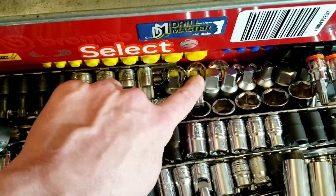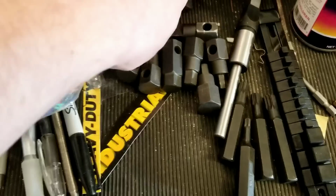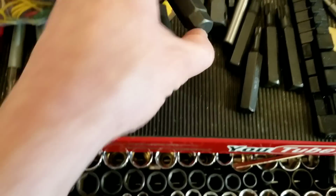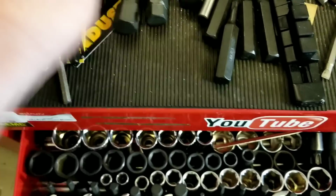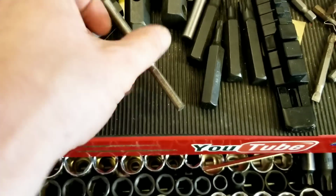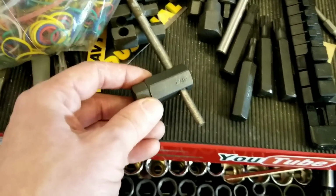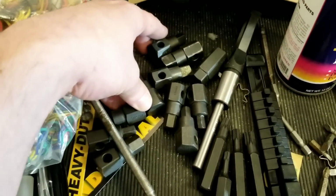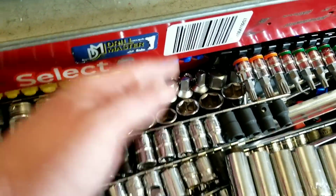So down here I did a review of this oil plug socket set. That was like the 2nd generation Harbor Freight. There's actually a 1st generation of these things. This is the 1st generation oil plug socket set. So oil plug sockets are various square sizes, internal squares, and certain common sizes of hex. And these you just use a 3/4 inch or 19 millimeter wrench on, or you would have something like this where you'd have a steel rod and you would actually slide it through the hole like that, and then use that as your breaker handle essentially. So they were really funky. They've actually held up okay, but they were just these totally funky items, and then they finally improved them to these, and then they stopped selling them, so go figure.